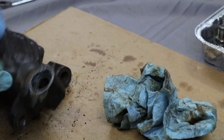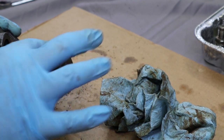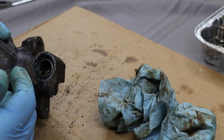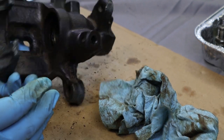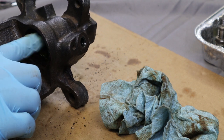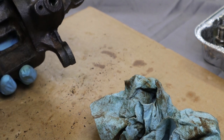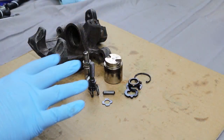There is a needle bearing down in here and I'm not going to remove it — this one looks much better than the passenger side, where it was corroded very badly. The factory service manual says to replace it but it doesn't come with any of the kits, and as long as the bearings work — which this one still seems to — I'll repack with grease and leave it. The next step is to go outside and blast this with brake parts cleaner: spray down through the piston bore, through the bleeder valve, and through the parking brake mechanism to flush out as much brake fluid, rust, and corrosion as possible. Then I'll come back once everything is cleaned up.